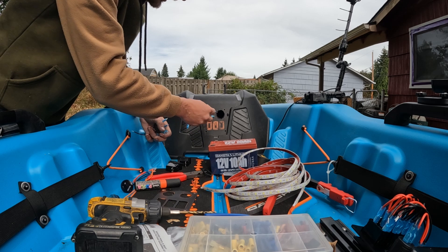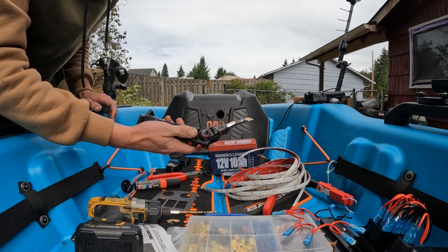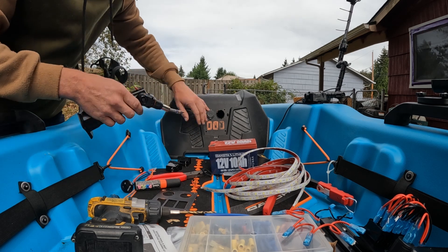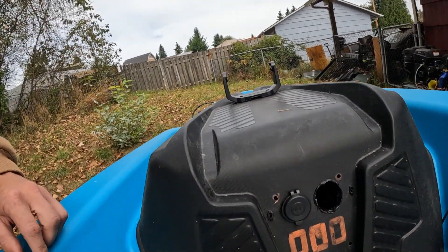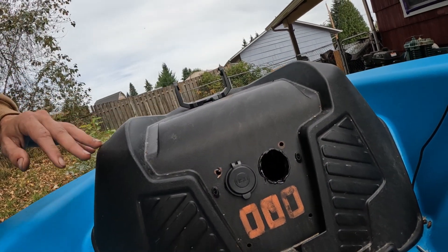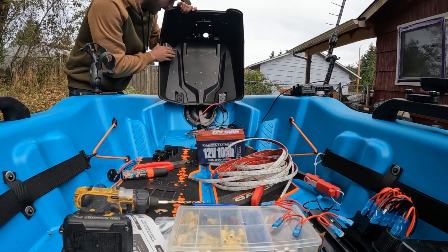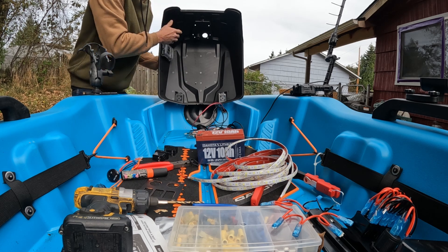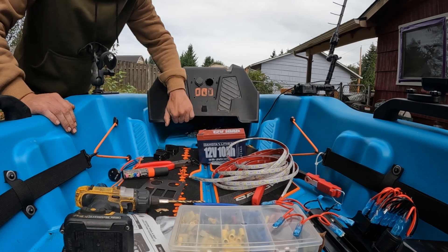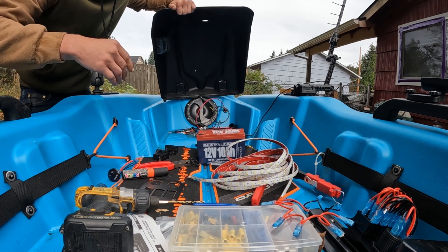The power connectors just snapped off — they're not a locking style by any means, so it wasn't that I took them apart incorrectly, they just snapped. That's rather upsetting, but I got another one so hopefully I can cut this out and get this all ready to go. The soldering iron I was using has a cutting edge but it bent a little after cutting for so long. I've got my fuse box already in and already riveted up. I'll grab some wire and we'll wire it up — the whole thing is made easy because I've got the breaker and everything else is eyelets.